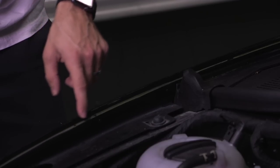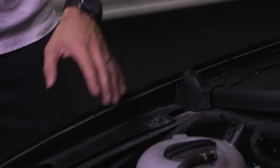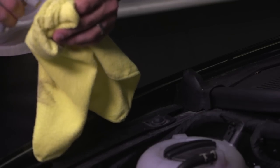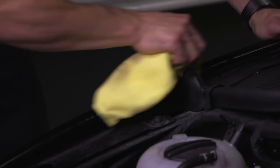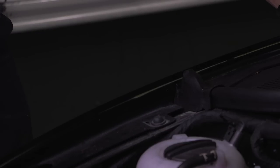Here's an area that went past the masking a little bit. We got a little overspray on the inside edge of this front fender where the hood comes down. So we're going to take our microfiber, saturate it with some dip dissolver, and just start working away at this overspray. All you have to do is be patient and little by little you'll get it to work away.